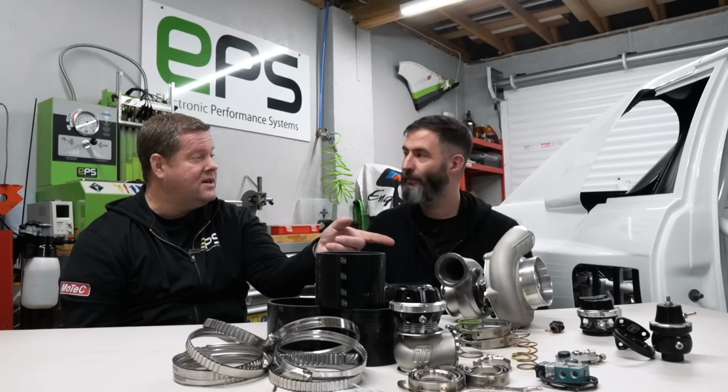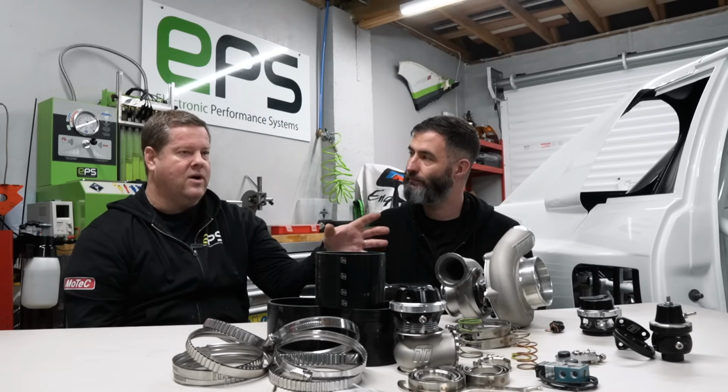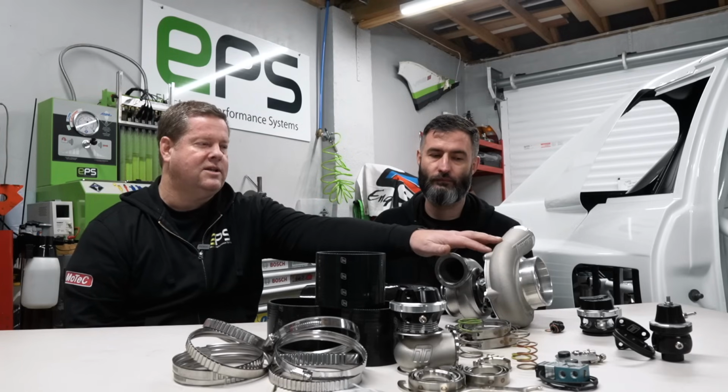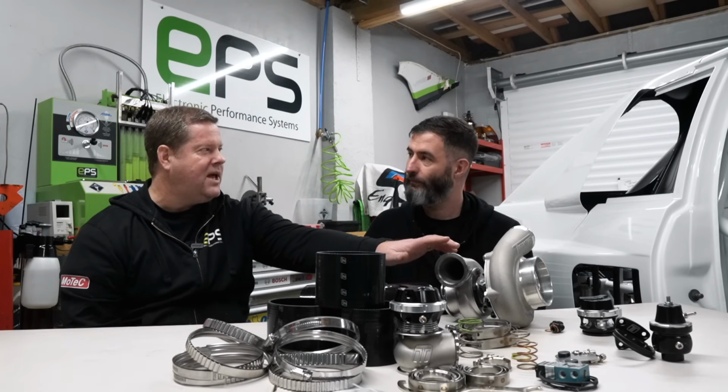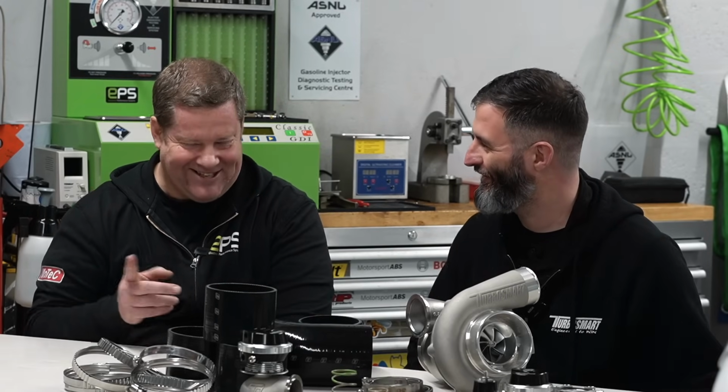Yeah, the Audi noise is special. There's something magical about that. And they didn't care about compressor stall. No, they didn't. So they probably never had one of those, did they? No. So that's why you hear that iconic noise, the noise you heard was this making the air go supersonic past the blades, wasn't it? Yeah. Because it's got nowhere to go, it has to come back out where it's been trying to push in, and that's when you hear the tugga tugga tugga noise, isn't it? Insert noise here.